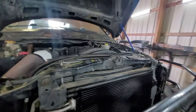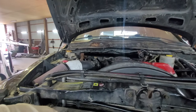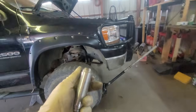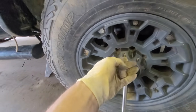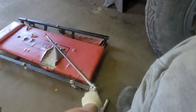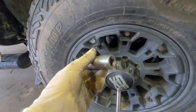This truck right now has the nice new AC stuff in. Everything is installed — we got the nice receiver dryer back there. So I'm going to show you guys this should be the last video on this. We're doing the lift kit now, and these lug nuts are in incredibly tight. These are supposed to be torqued at 140 foot-pounds, and they were not. My Milwaukee is struggling, and even with this half-inch breaker bar it's struggling. These are 19-millimeter.